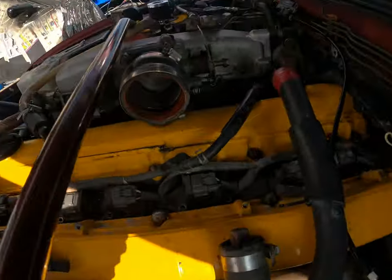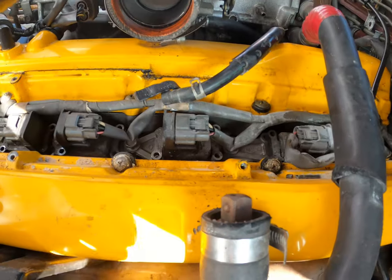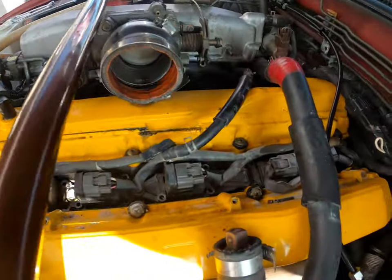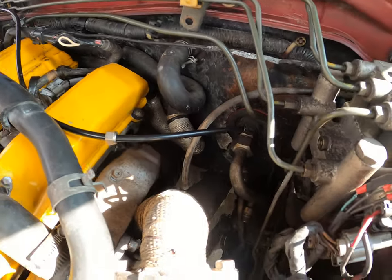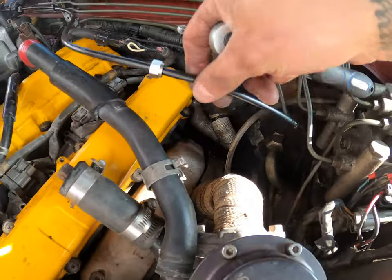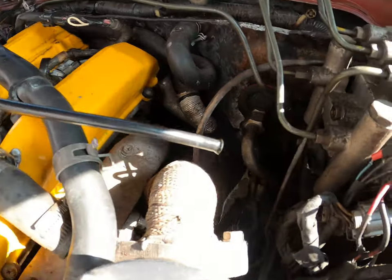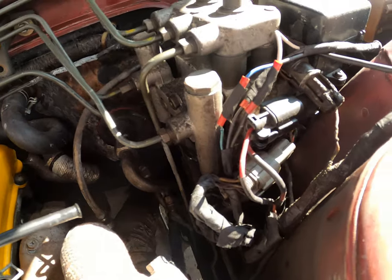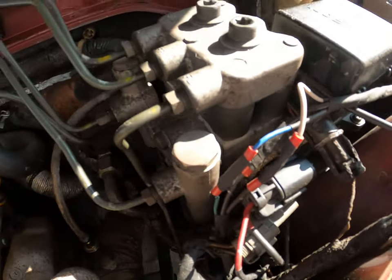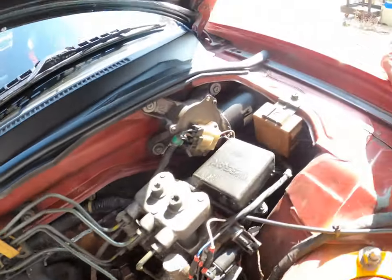There's still residue from the fire extinguisher inside the coil packs. I haven't changed plugs since then. I've serviced the car with just an oil change. And if you have a look here, is where the fire was from the methanol. So this methanol pipe over here perished and had a pinhole, which caused the fire on the downpipe over here. And my ABS light's always on now. I had to cut and rejoin wires, and my aircon doesn't work, my heater box doesn't work, and yeah, 10,000 k since, car still going strong.